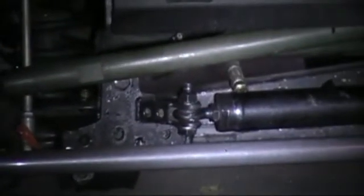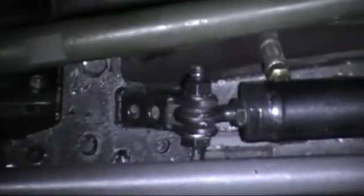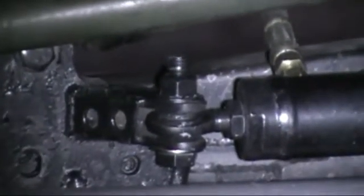Once your passenger side flexes up, your drag link is going to want to become parallel to your tie rod, so this area right in between here is going to get really tight. With mine fully flexed, I have just nice clearance right around the mounting bolt. And once I cut off that extra bolt sticking out on top, I'll have even more clearance.